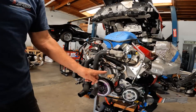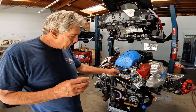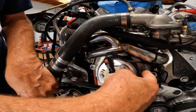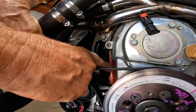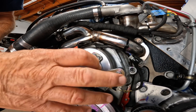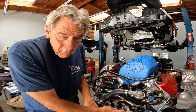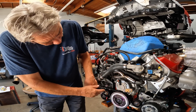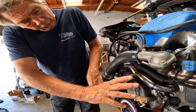Okay, motor's come out again. The problem was we had a cam crankshaft phasing problem between this crankshaft and that cam phaser. The computer told us we had 16 degrees difference where something wasn't lined up right, and that probably was because we made this timing cover. The bottom part that's red actually came off of a Volvo 8.1, and this chunk here came off of a 2014 to 2017 small block timing cover. So it's got the cam phaser and cam sensors. We used it because this sensor here is the same as the one used in the C8 — we had commonality there. When we welded this piece onto the timing cover, we fit it in and figured that was close enough. Apparently it wasn't.